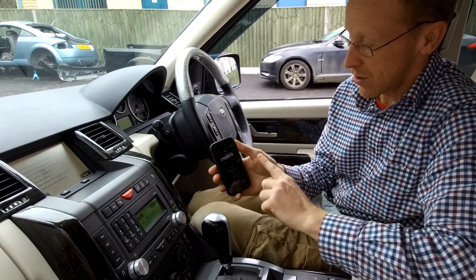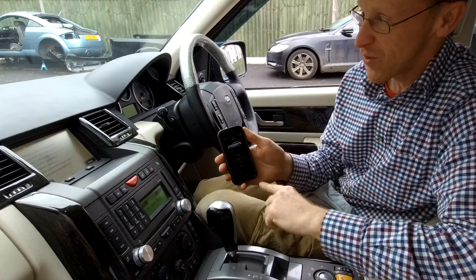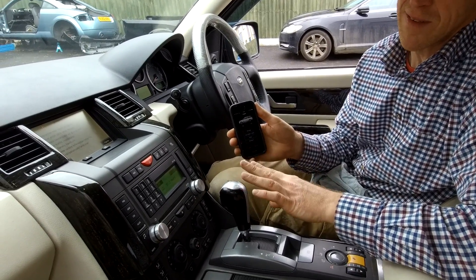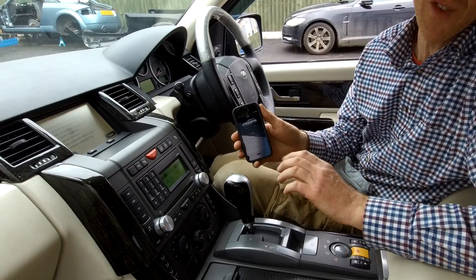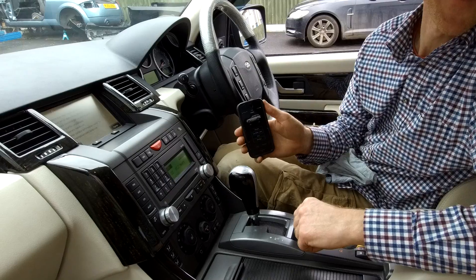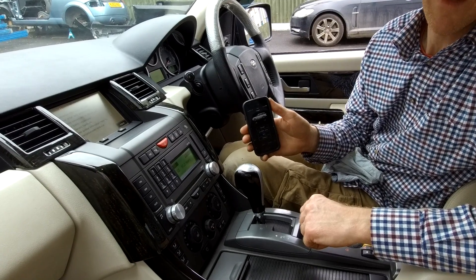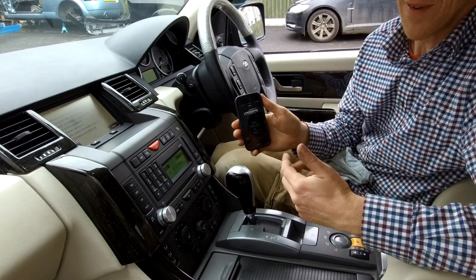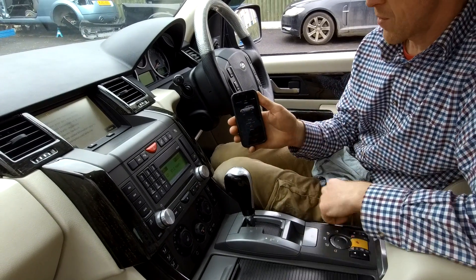Do be careful - the other disclaimer I'd say is you can get some funny tire wear and slight changes in stability if you mess about with your suspension too much. It's the same as any suspension changes - you should go and get your tracking and alignment redone. But if you're just going out and want to get it set lower, it's a good job. Good luck with that.